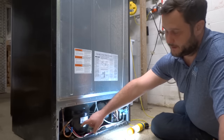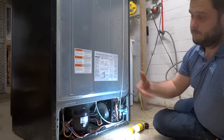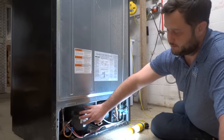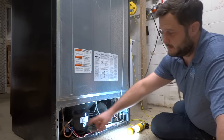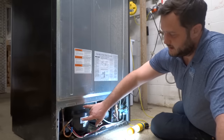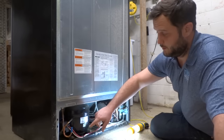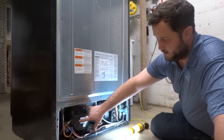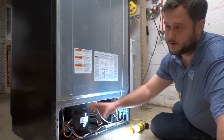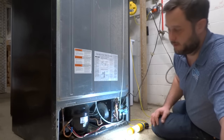While you're checking it, if you hear a clicking sound — maybe it clicks or tries to start, then you don't hear anything, and you wait another few minutes and hear another click — that means we've got a problem with the relay. It also could mean there's a problem with the compressor itself. You want to cross your fingers that the problem is here at the relay. If it's a relay problem, you can fix that and we're going to show you how. If not, you've got an issue with the compressor, which is really not repairable. The part's not too expensive, so it's worth a try. We're going to show you how to take this apart and put on what they call a three-in-one start relay kit.